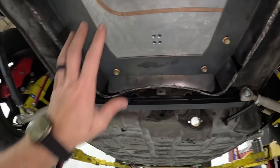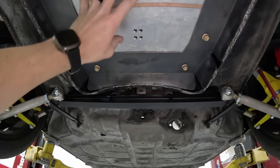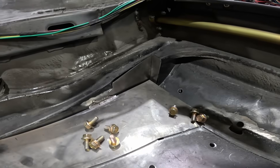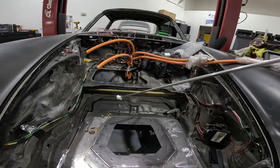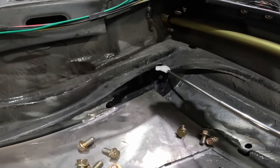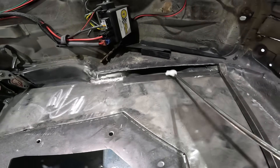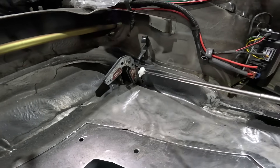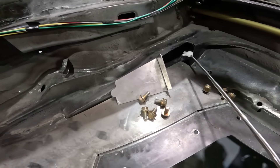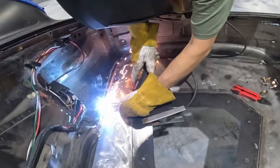It should stiffen up the vehicle really well. I'm going to remove these bolts, take the battery box back out and do the welding on the top side. Up next, we're in the front compartment for the battery box that's going in here. We need to weld in some little patch plates — we're left with some small open areas — so we're going to weld in some plates in these holes. We're going to get them all in place, tacked in place, and then weld it all up.